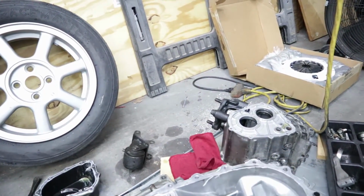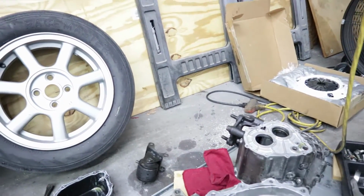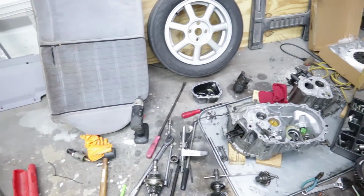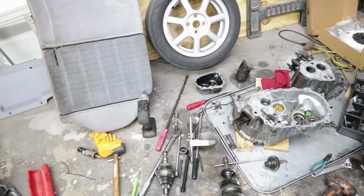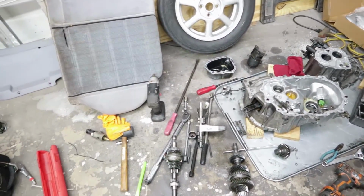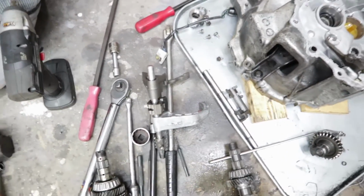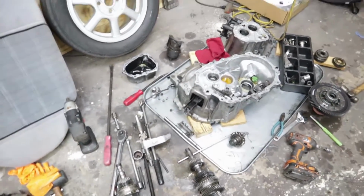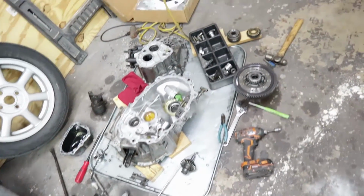That's why it was only in second and fourth gear, because in second and fourth gear that rod moves up. First, third, and reverse, that rod's down. There were a few times where it felt like it got stuck in those gears, and I'm thinking maybe it just got bound up, because it felt like it got stuck, but it didn't feel as bad as when I got locked out. So yeah, pay close attention when you put stuff like this back together.